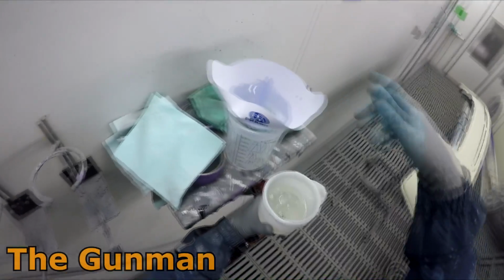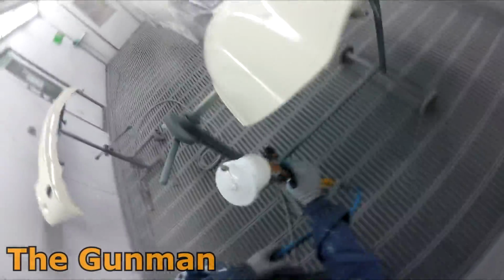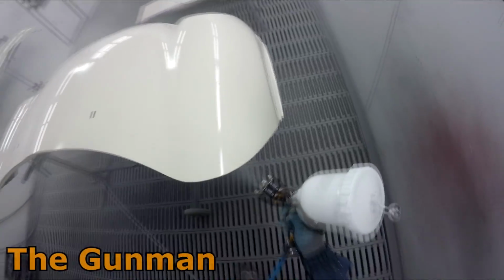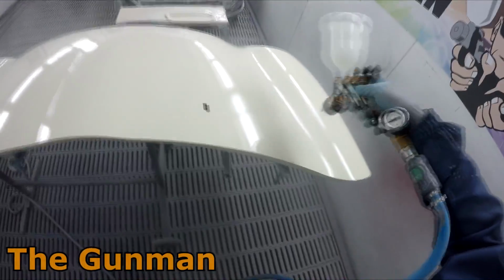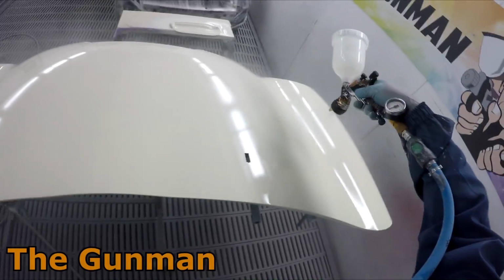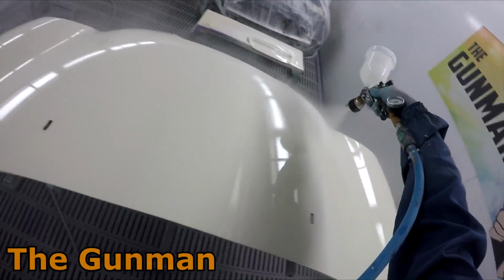Someone in the comment section told me that what that additive is, is like a little bit of reducer and thinners at the same time. So yeah, it works brilliantly in this. You do have improved drying time. If you use this quartz liquid glass, maybe even with just a standard thinner, your baking times and your dry times would probably be quite a bit higher than with the VOC speedster additive.